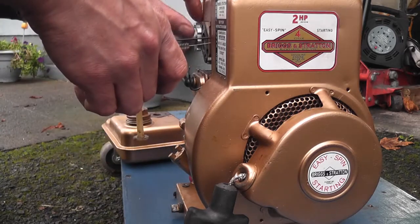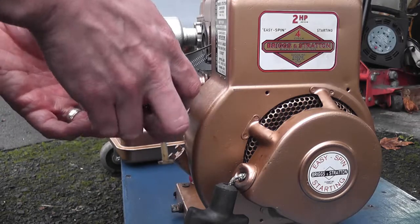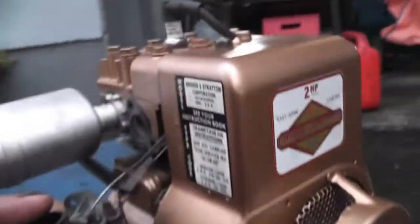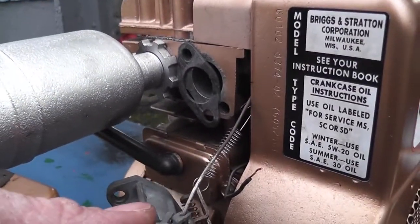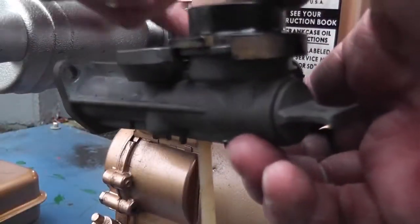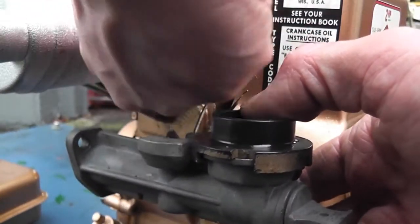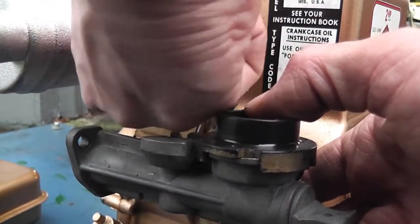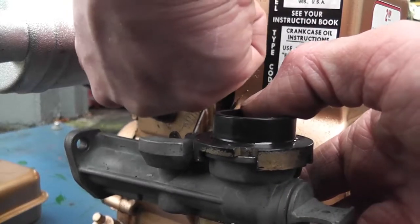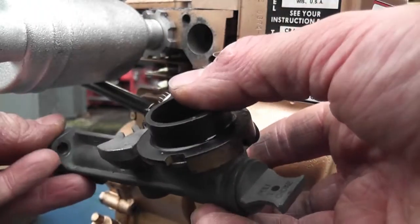Now you can actually see where the gasket was. Oh right, hang on a second. The gasket obviously dropped off. It's actually stuck there, but it's my own silly fault. Alright, that's good because we found our culprit, hopefully. Well, it can't not be that, really. So, the engine will never run right with it like that.